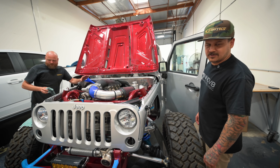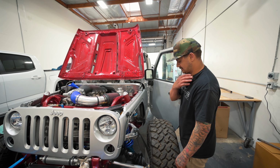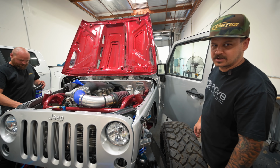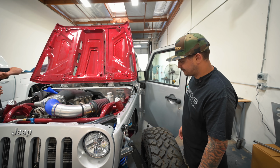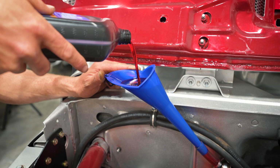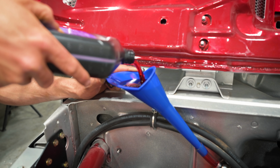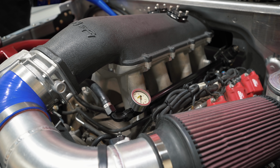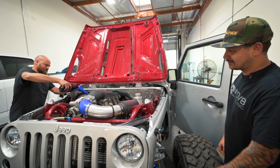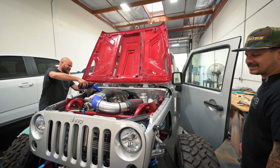We are checking the fluids again, cycling tranny and engine oil through the cooler, making sure we're not going to run it dry, but there's plenty in there, just topping it off. Just added a fuel pressure gauge so we can set the fuel pressure, because there's no way to read that. Got that stupid oil block not leaking now.